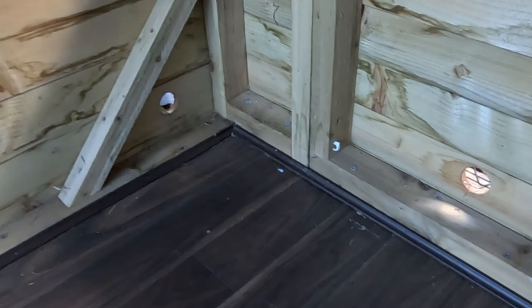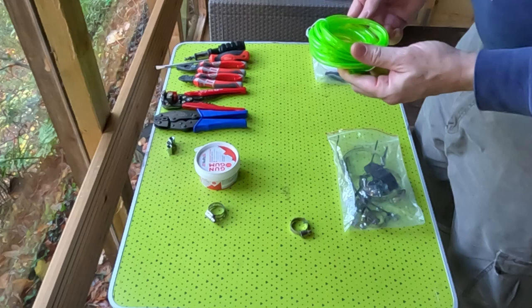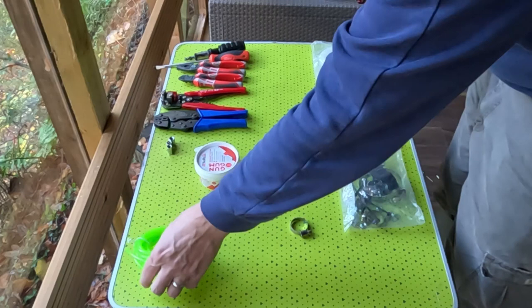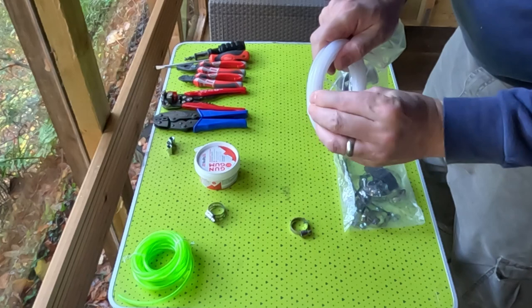inlet through the floor. This rubber hose that's come with this kit, in my van when I installed the diesel heater, this hose perished and started dripping oil. You know, the diesel oil started dripping, seeping through the actual hose. So I'm not going to use that. You can get kits on eBay that come with a hard plastic type hose. So they come, it's more like a polythene rather than a rubber type material.